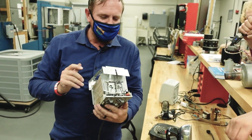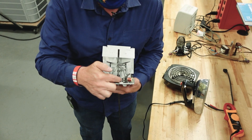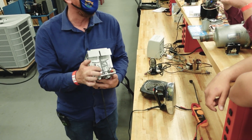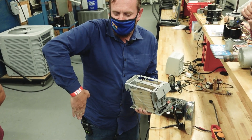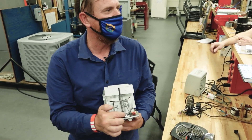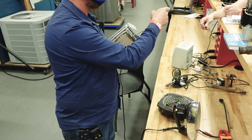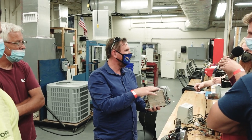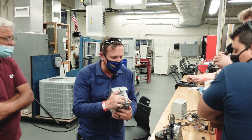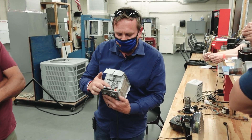This is beautiful — this is so cool. On this side, we have this little dial right here, and it's for lighter or darker toast. What it's doing is changing the distance between that rod and this piece of metal right here. If I put it over here, this piece of metal is very far from the rod. If I move it over here close, that piece of metal is very close to that rod. So if I move it close, this heats up just a little bit — a little bit of movement causes that rod to touch here. If I move it very far away, the bi-metal has to warp a whole lot before it touches this piece of metal. It's essentially a timer based on temperature. Exactly right.